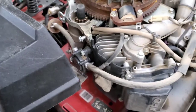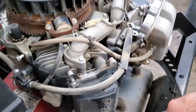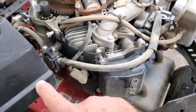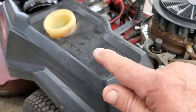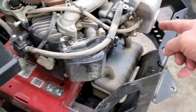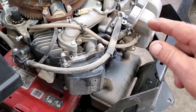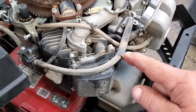Replace this fuel filter. Be sure that when you hook this back up, put fuel in, disconnect your fuel line to the carburetor, place it in a jug, and then crank the engine over to make sure you flush fresh gas through. That way you have nothing left in that fuel pump of water that could be settling in the bottom of that fuel pump. Add some fresh gas to the tank after you have cleaned that water out, and then run this into a jug so that you can take that to the recycle place — you don't want to dispose of that in the wrong way. Get all that fuel out, drain that carburetor, and try it. And if it still gives you a fit, then you'll have to pull the carburetor. But if you get this water out, nine times out of ten it'll work itself through once you clean all this out, and you'll be good to go.